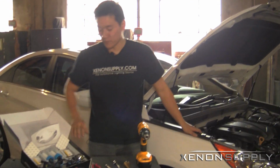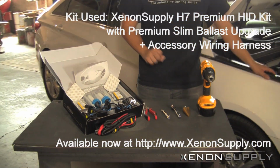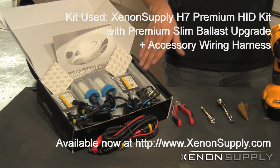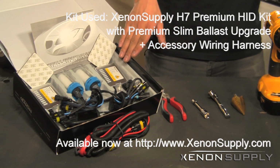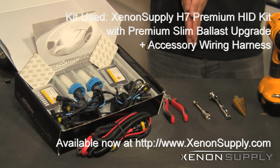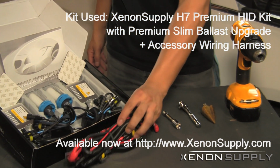What we have here is an H7 premium HID conversion kit from XenonSupply.com. Today we're using the 6000K color temperature for the bulbs, and we are using the premium slim ballast upgrade with the double-sided mounting tape for an easier installation. This kit does come with the accessory wiring harness for pulling power directly from your battery.